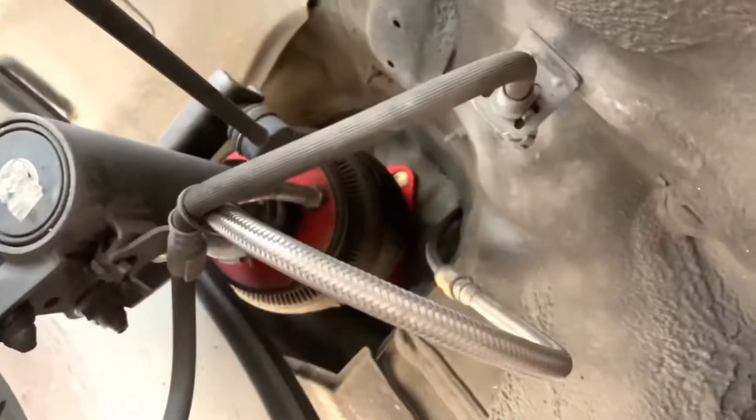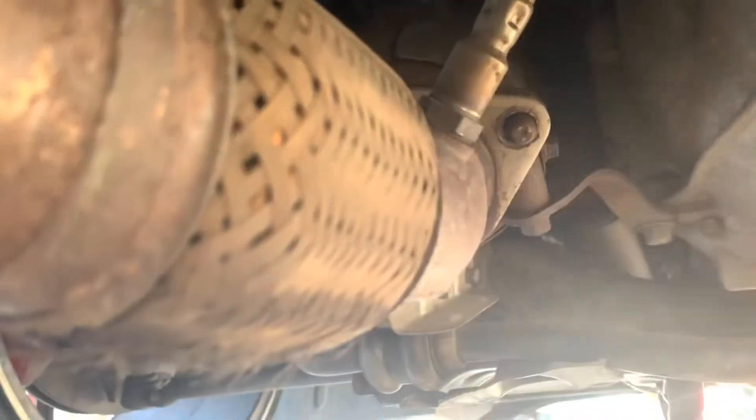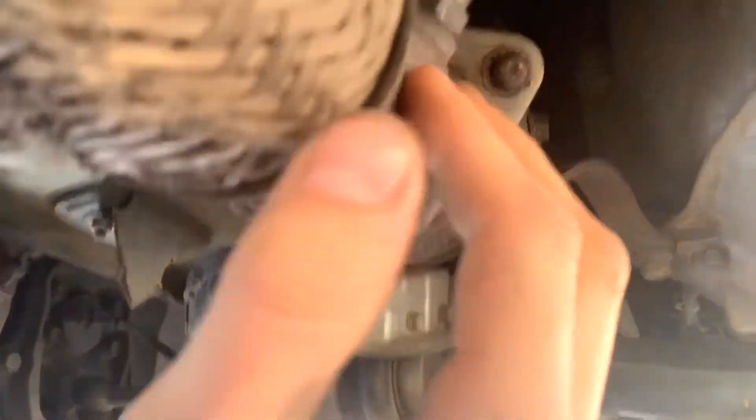Now we got the bags, but we like to cruise low so we're still scraping. All right, so we got all four bolts off — two back ones, two front ones — so everything is free. I'm gonna remove the O2 sensor before I start taking this apart, so it's not dangling. Same thing on the other side. Still gotta get all four nuts off on that other side, but easy process.